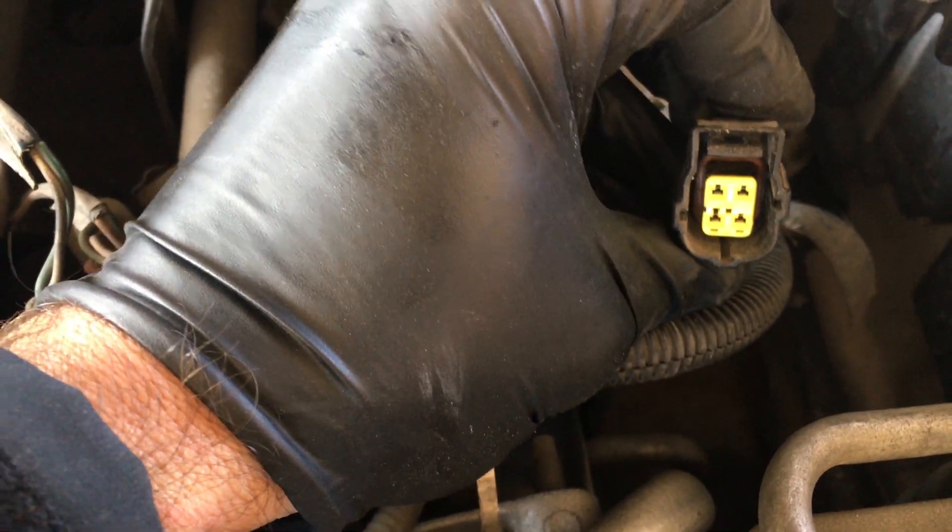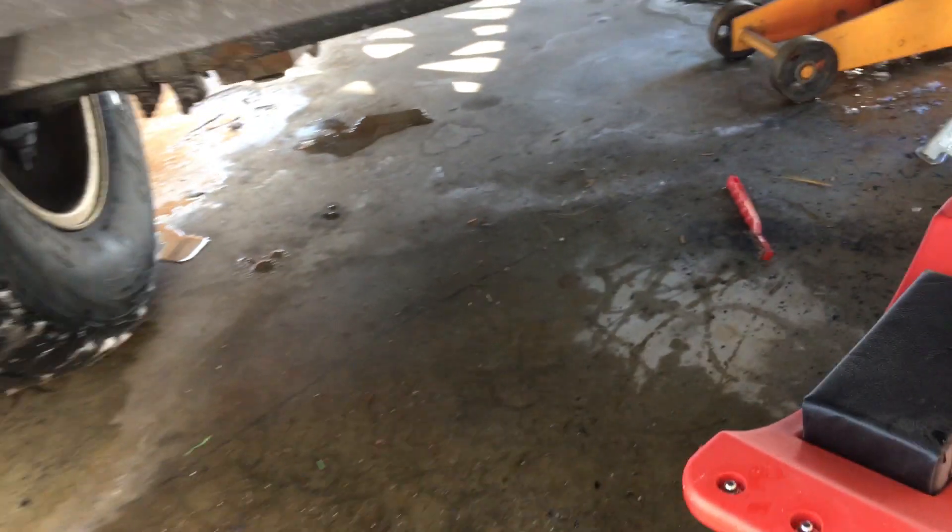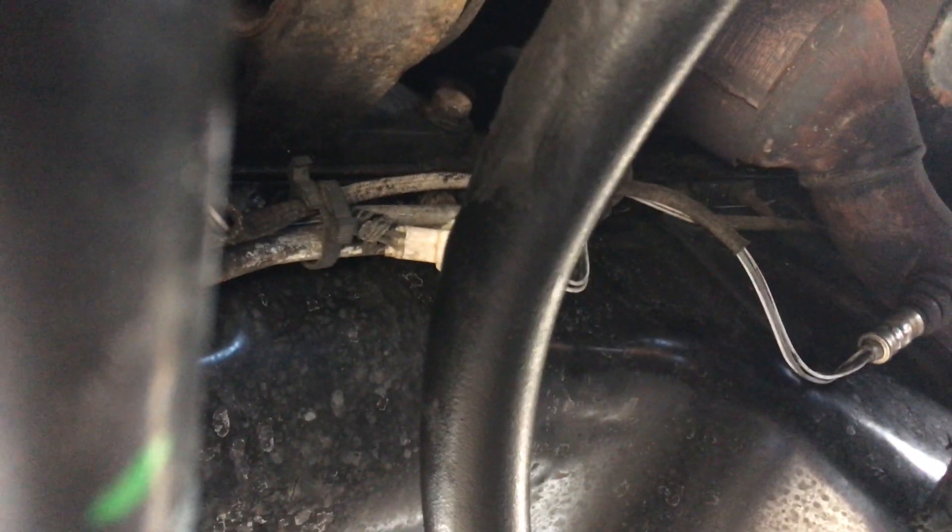You can see that that matches. Going underneath, what I originally did is took the wrong sensor out. You can see there is the other sensor, which has a white covering — kind of hard to see because it's a little dirty under there. You can actually see the two wires for both sensors. The keyway on that one, the right side is lower than the left side, so I was unable to clip it in. You can see this is an entirely different connection than the other two sensors.